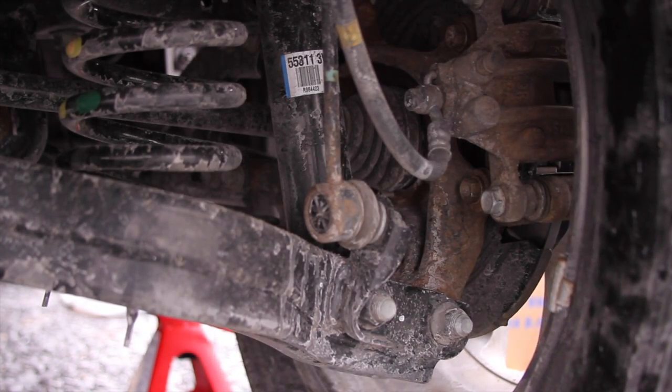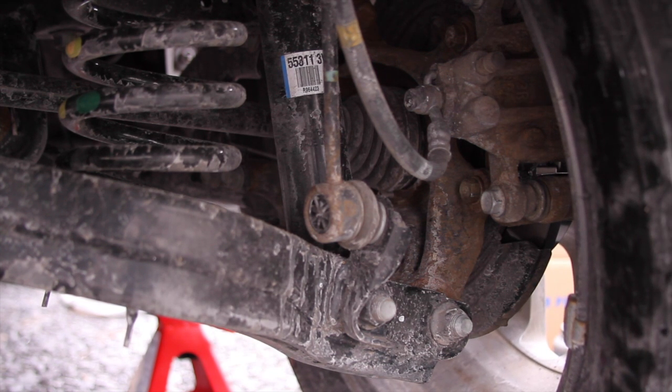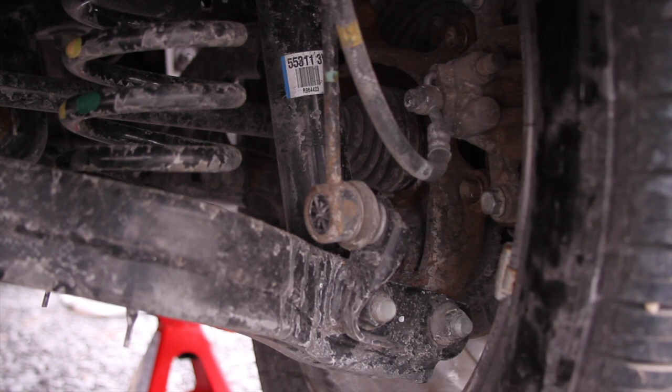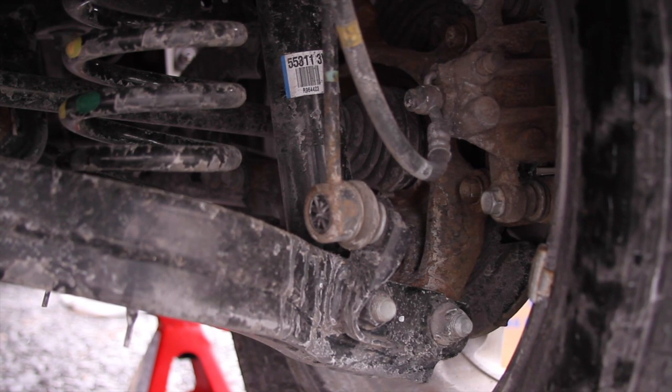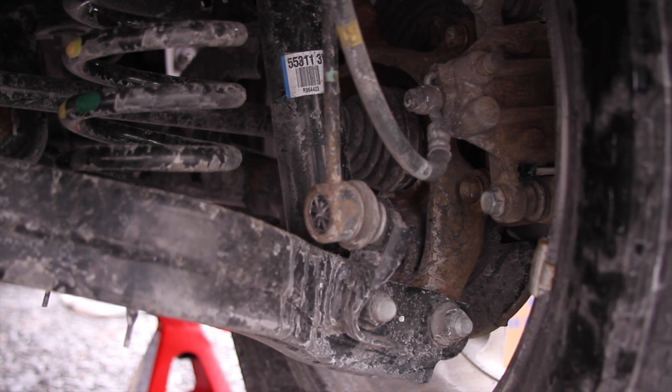Okay. Let's go ahead and grab our lug nuts and our impact gun. And we go forward. I will be torquing this down to spec. I'm going to turn this down a bit, a little too much force behind it. Star formation when putting it on. There we go. Next one. There's another one. Another one. And the last one.